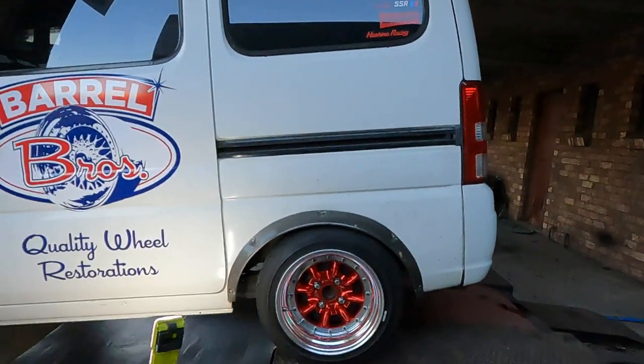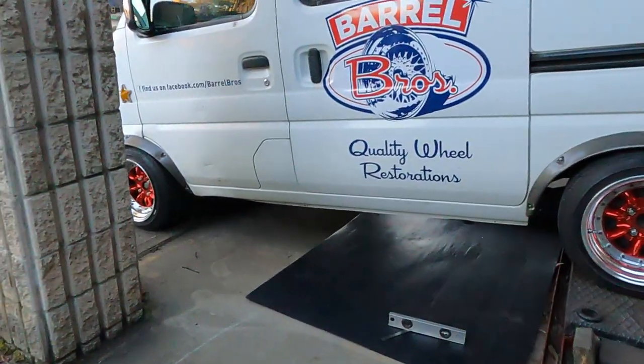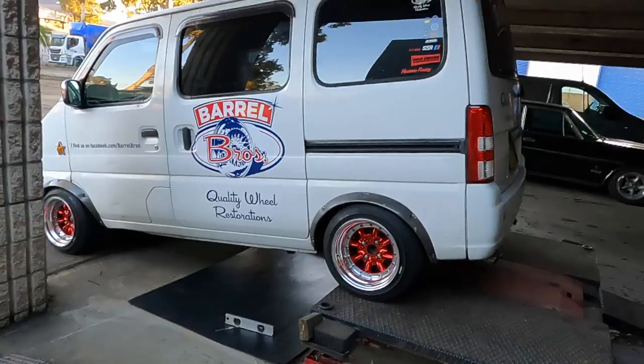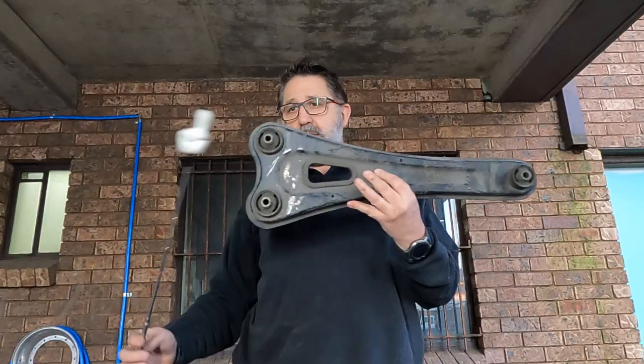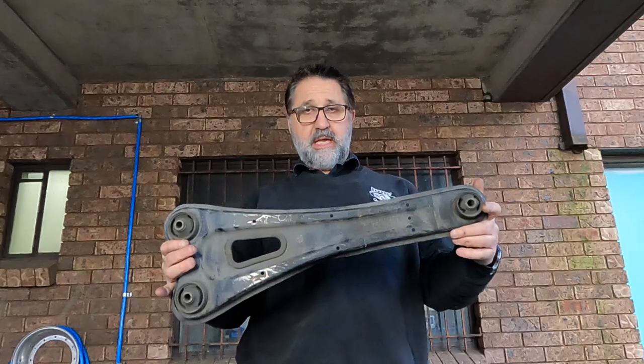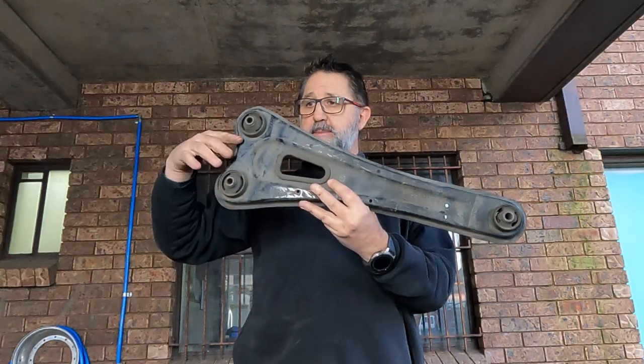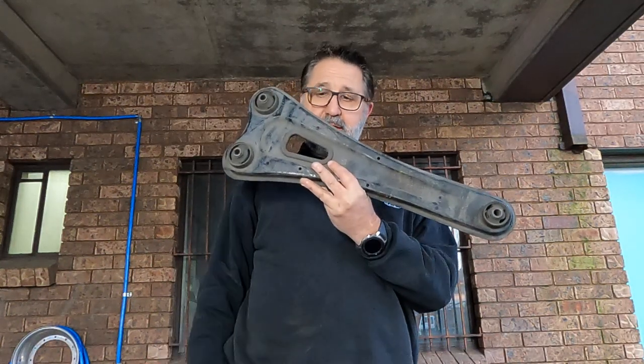So we lowered the van. Damn those wheels look good. This is a coil sprung live rear end, basically on an arm. This is the rear arm - it pivots on there and these two are attached to the diff. What we did is they normally sit like about that, and we said let's lower it four inches. Which is all well and good, except the diff is attached to this, and as you go up now my diff's pointing down at a really bad angle, and of course it flogged out the pinion bearing very quickly.